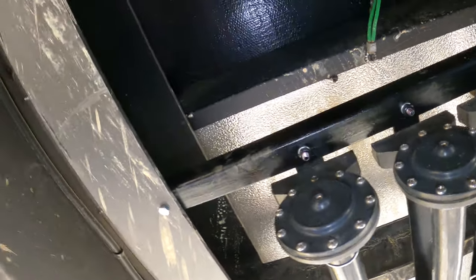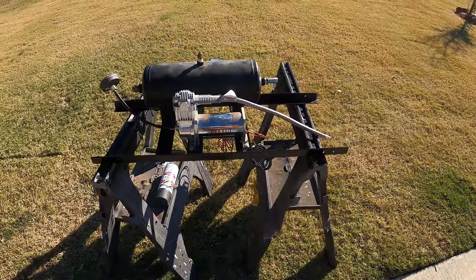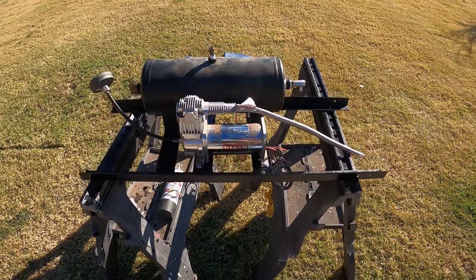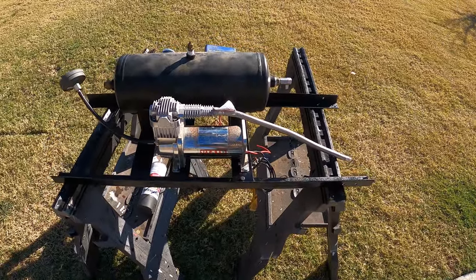Now to install the air compressor and tank — they're going to go right here in this void. Got to go fabricate another bracket. It took me a while — it's late afternoon now — but since I got the horns mounted we had to go do some shopping and buy some material. This is the framework that'll hold the compressor and the tank, very similar setup. This is going to rest on the underside of the frame and we'll bolt it to the frame.